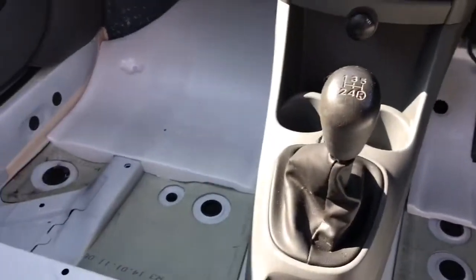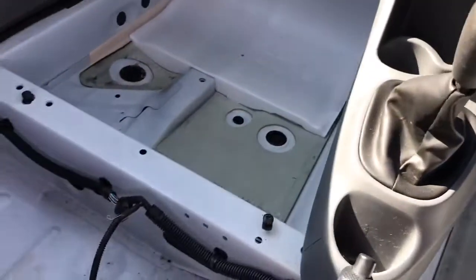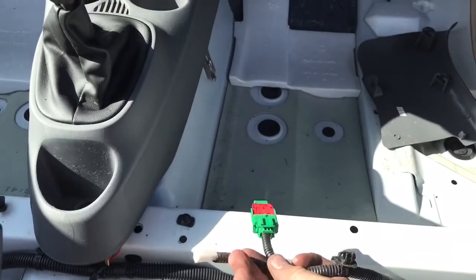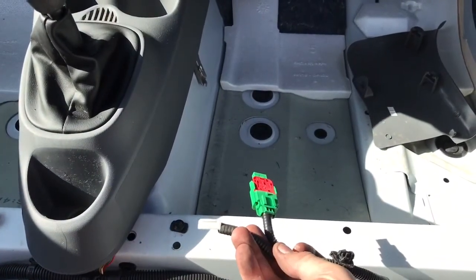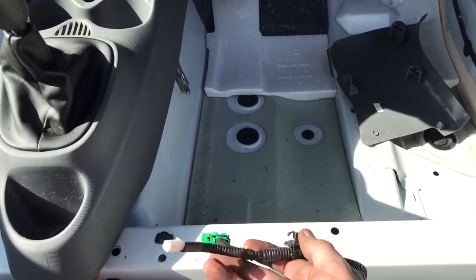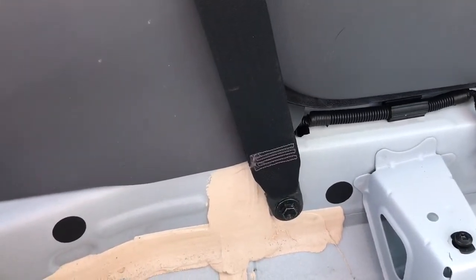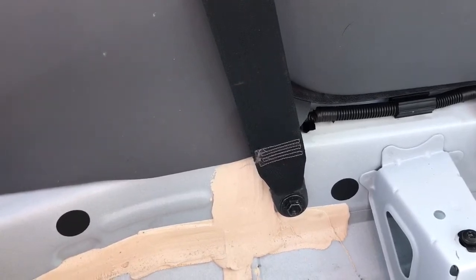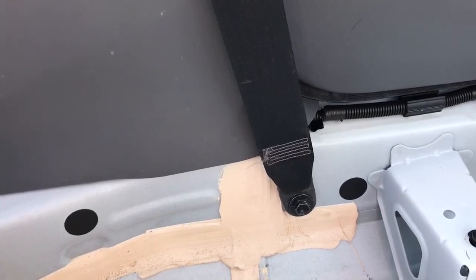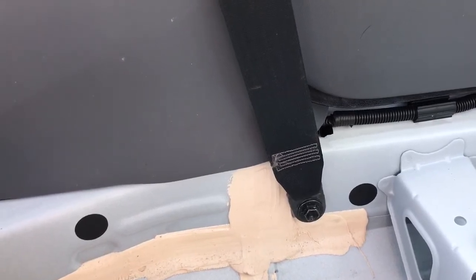All in all it's taken me no more than half an hour to get the carpet out in its entirety without damaging anything. On the driver's seat there are two clips - the white one just unclips from the seat, and then there's a second clip holding both of them onto the seat, which needs a trim tool to get out. Also worth mentioning: the carpet runs behind the bottom of the seatbelt for the front. That's a 14mm bolt - came out quite easily - and the carpet comes out from behind that. You can probably just loosen and cut the carpet away, but I've undone it and done it back up.